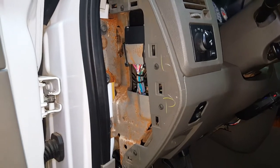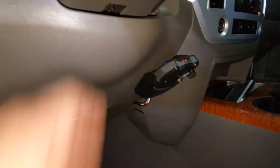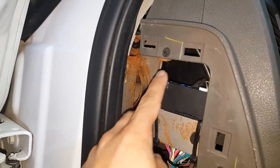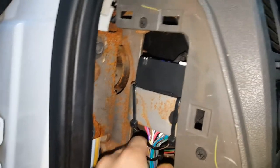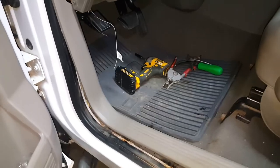If you can't reach behind it, push the headlight switch forward from the back to give yourself more room to work. I plastic-tied the module to this bracket here — it works out perfectly with the length of the wire from the main harness. You could put it under the column cover anywhere or velcro it, but this spot is great: LED lights and program buttons are accessible, connectors reachable from top or bottom.